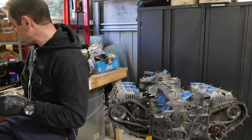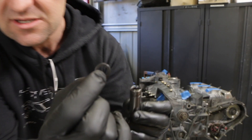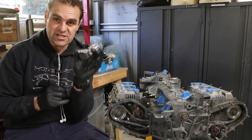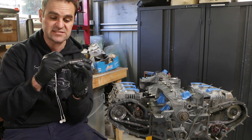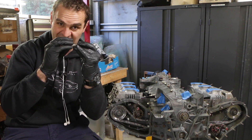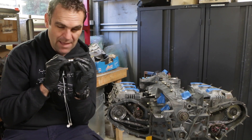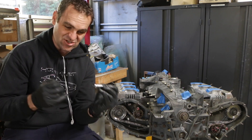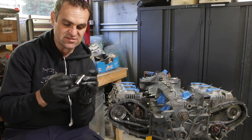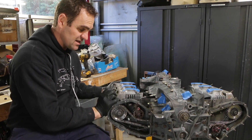I've got my rocker shaft here and my RSR seals. These are basic little rubber seals that go in the grooves of the rockers. Originally these engines didn't have any seals on them. Basically there's a bolt that goes through with conical nuts on either side, and they push into the center of the shafts and stretch them out just enough so they're tight in the cam tower. The trouble is, if there is any gap at all, that's where oil will leak out. So another place where you want to avoid leaks is the rocker shafts, and that means setting up with RSR seals. I'll put them on now and then we'll install the rocker shafts.